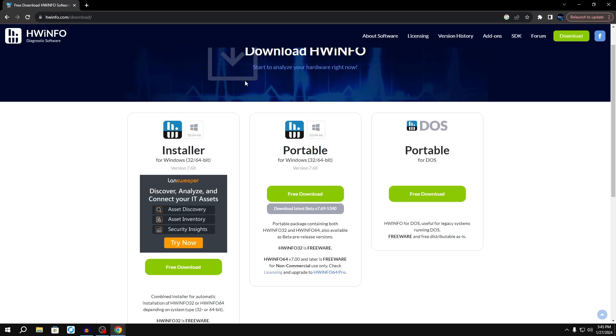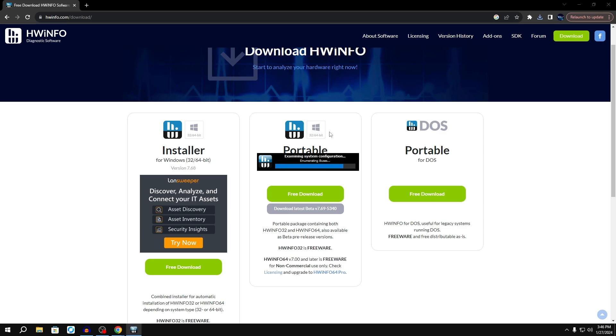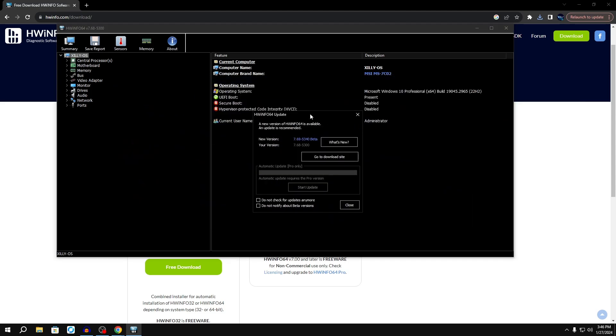For Ryzen, this is where Hardware Info comes into play. It's a tool that lets you figure out which controller on your PC is the CPU USB controller. You want to plug your mouse, keyboard, or controller into the CPU USB controller, not the chipset. Go to the link in the description, download Hardware Info, hover over portable, click free download, then local if you're in the US. Double-click the file, open it with 7-Zip or WinRAR, double-click HWiNFO64, click Start, and it will analyze everything.